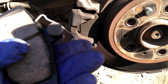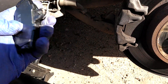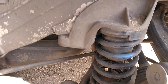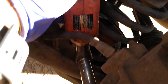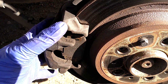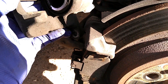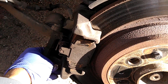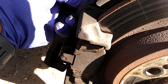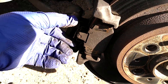Here's the new pads — little dingy looking pads, but these are for your all-wheel drive cars. Let me go ahead and pry those open and get those pads out of there. Those two bolts are 13s, so you pull those out and then the caliper comes right off. As you can see, I already compressed it — you want to make sure it's not damaged. Check the pins in here; you can take the boots loose and grease those pins, clean and grease those up.